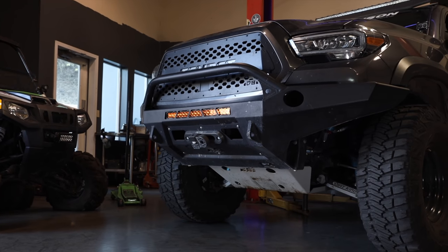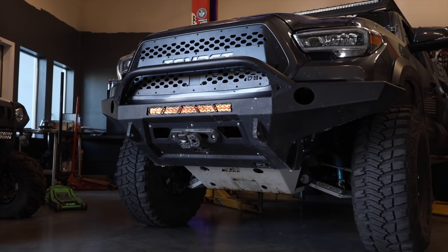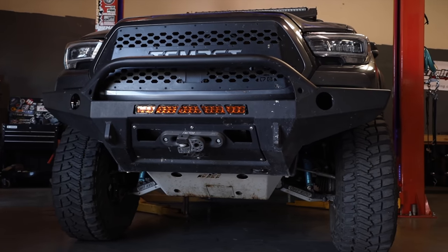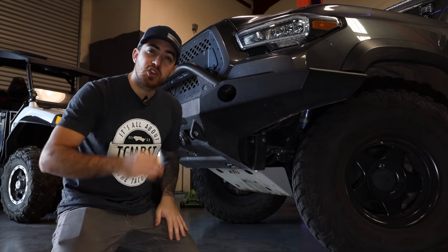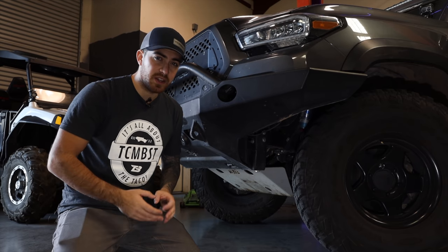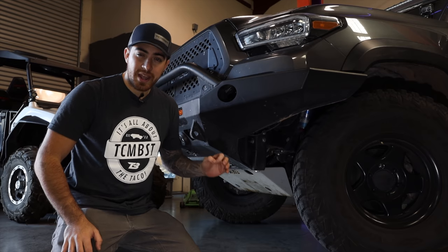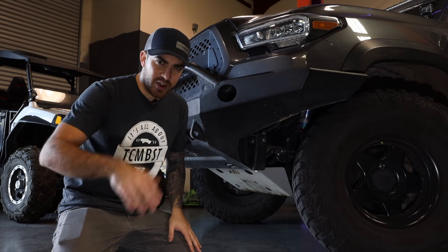Moving towards the front of the vehicle, you guys can see we have a high clearance front bumper. There won't be any need to trim or cut up in the front — take a look at how much clearance we have. For those of you that want to keep your stock bumper and want to see how to cut up in the front, make sure to subscribe to our YouTube channel. We will be working on a video specifically for that. But on this video, we are going to show you how to relocate the body mount behind the firewall so you can fit your 35 inch tires without any rubbing.